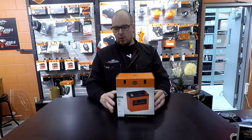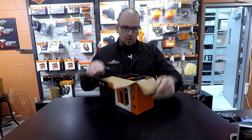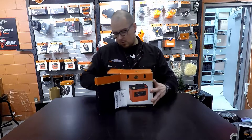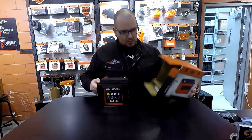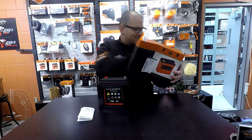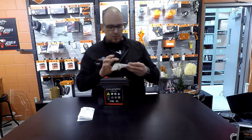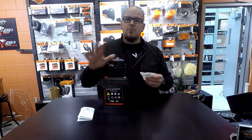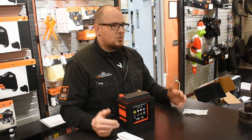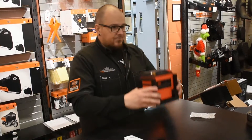I'm going to get right to it and open it up. In the box you're going to get a battery, a set of instructions — because everybody needs to know how to install a battery — and some brand new hardware. If you're going to the new lithium-ion batteries, you definitely want fresh hardware, something clean with nothing rusted or pitted, to ensure really great contact from the battery cables.